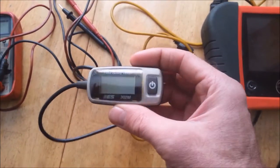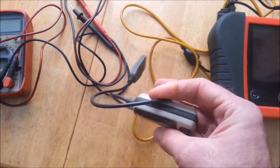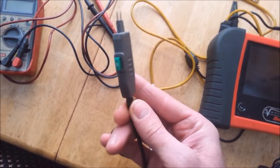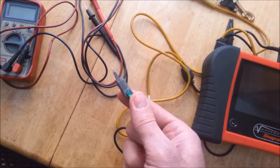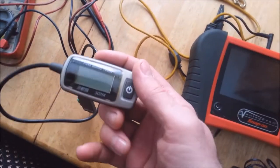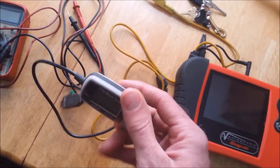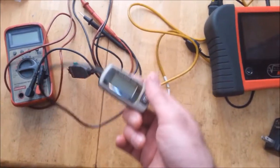You can also use one of these — it's a fuse buddy. I paid like $35 for this. It's nice because you can just plug it into a circuit where the fuse is, and you'll blow fuses if it's something really bad, but you won't hurt the tester at all. The only thing I don't like about these is the battery — it's not a regular triple A, it's some fancy camera battery that costs a bunch of money. So I don't use it very often.